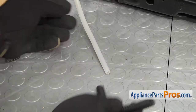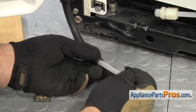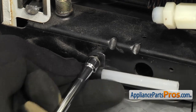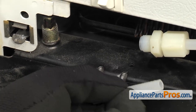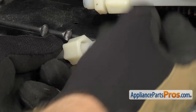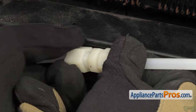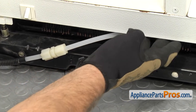With the hinge remounted, we can reattach the water line. First, we're going to put the protective cover on it and slide it all the way up. Then we can slide the clamp up and use the quarter-inch nut driver to mount it to the frame. With the water line mounted to the frame, we can reconnect it to the union. We're going to slide the nut down so a little bit of the tube comes out. Then we can grab the water line — if it unclips, it's okay. We'll just push the union down until it bottoms out, then slide the nut up and tighten it down so we get a good seal. Once you have the union tight, we can reclip the water line to the little clip under here.